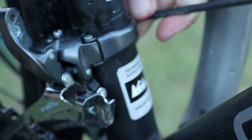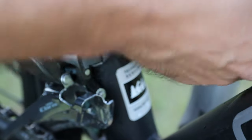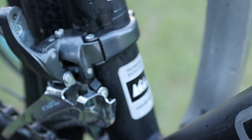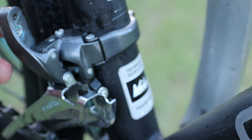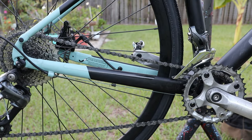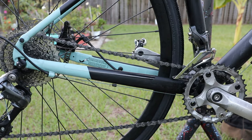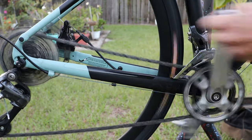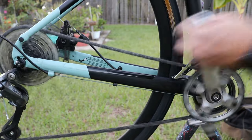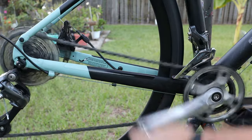There's no more adjustability - it's pretty much it. And it's still a bit higher than it should be, but maybe that's good enough. Then I don't have to mess with it any. Of course, I need to adjust my cable now. Fold around getting the shifting all right and everything. So right now we're in the smallest in the front and the second to the largest in the back. Go ahead and shift it to the biggest in the back right now. There we go. Now we're in my absolute granny gear setup.